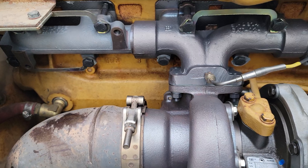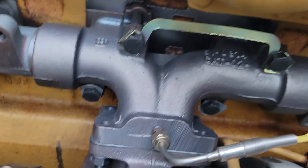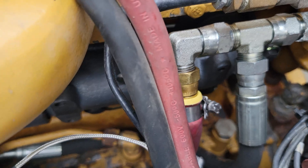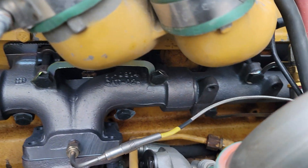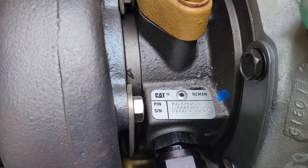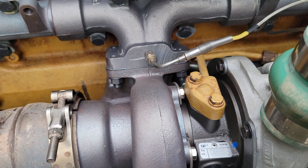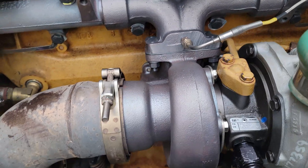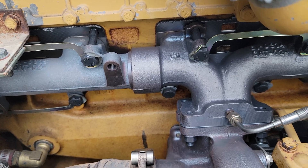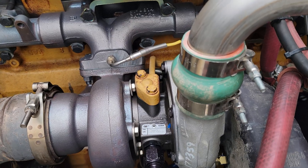As far as exhaust parts — the three-piece manifold — I'll leave links in the description to the eBay listings I bought these from. You can reference them for part numbers. This one is 61-0915, the middle one is 61-0914, and the third is a number I can't remember off the top of my head. The turbo is a 10R6402. Alternatively you can look these up on the CAT website, but it'd cost upwards of five thousand dollars there. I paid about $250 for all three manifold pieces, $125 for the gasket and bolt kit, and $350 shipped for the turbo.